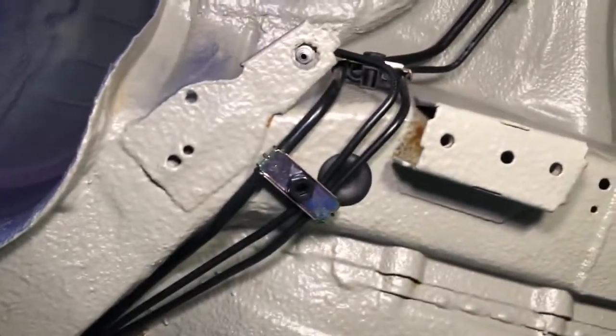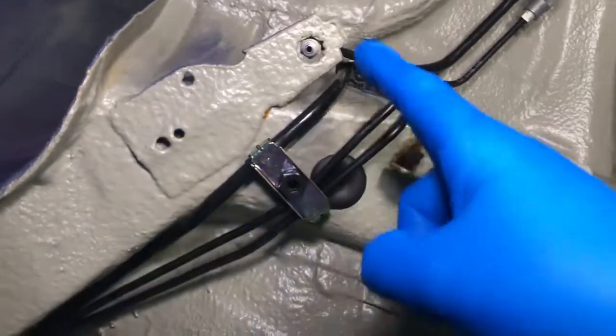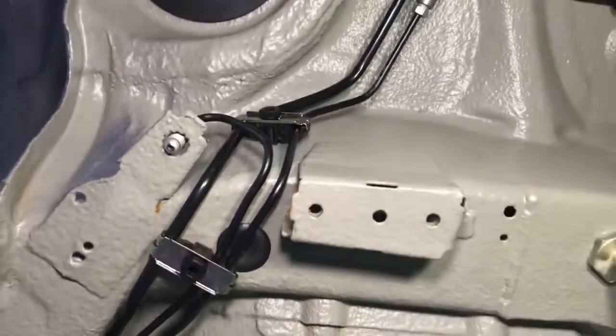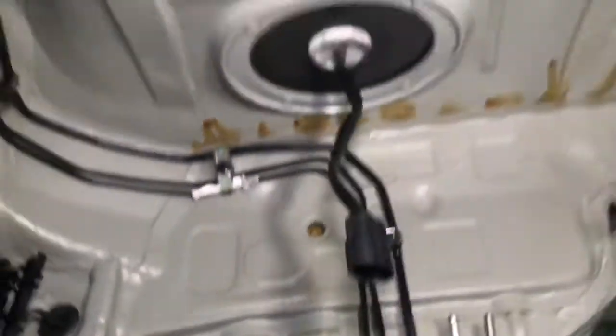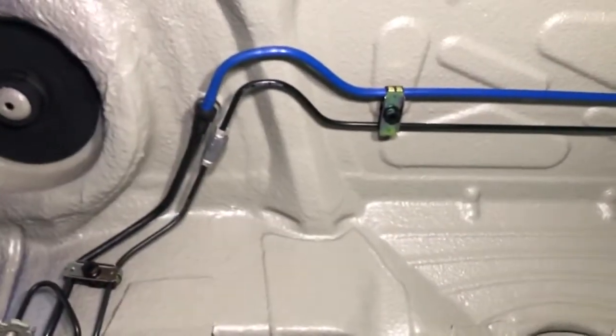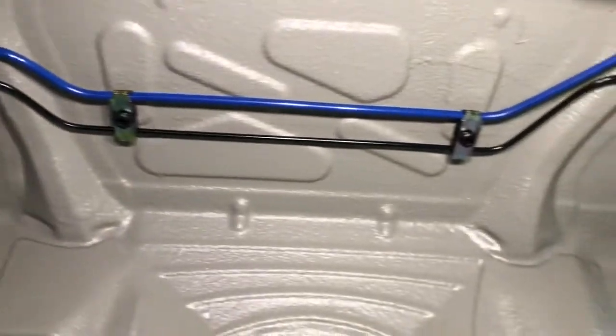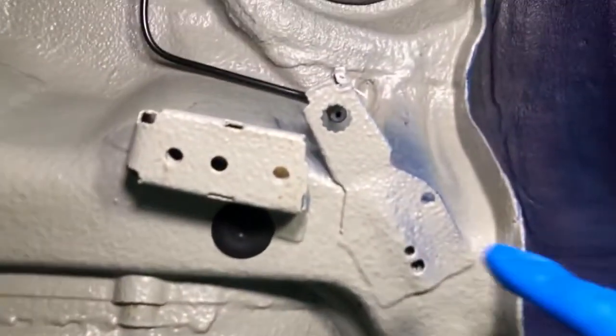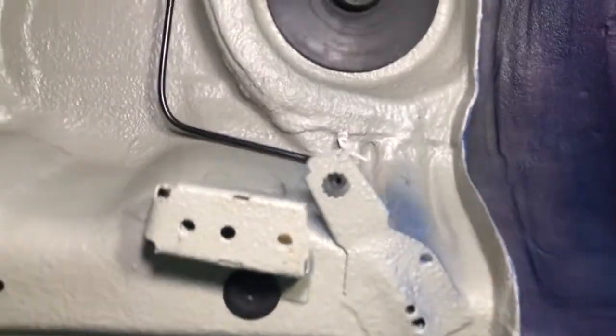Now these are the new Reedish Motorsport brackets, so there's one there that comes out perfectly in the middle, and then we've got the fuel tank brackets here, and that's the other Reedish Motorsport ones there as well. And then they go over the axle, OEM join location, and then go across the top of the axle to supply the right rear brake flexi in the bracket, which is that one there as well.